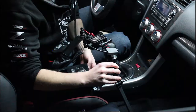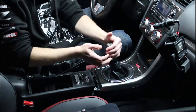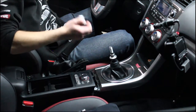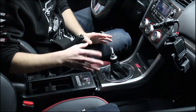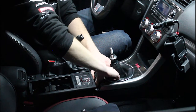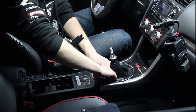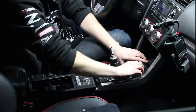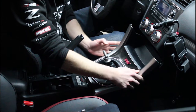There's a little clip that pops out and then two grooves right here — lift it up, pop it out first, then push it back. Next, we're going to remove the shift knob. Once you get the shift knob off, you're going to pull up on the plastic piece. The best way to remove this piece is to wrap your hands right here and pop up. If you're trying to get it from the sides or the front, you don't get a good grip, so dig your hands a little bit into the shift boot and pop straight up, then pull towards you a little bit.